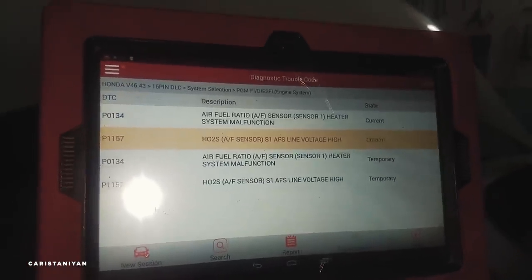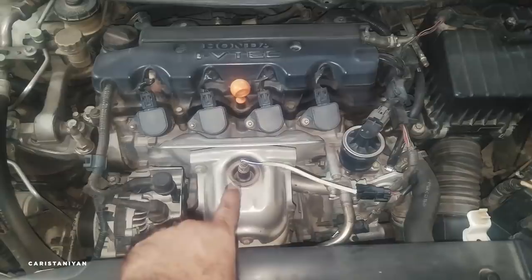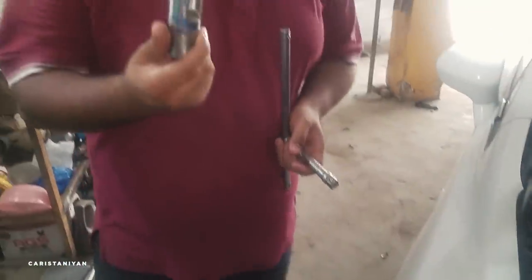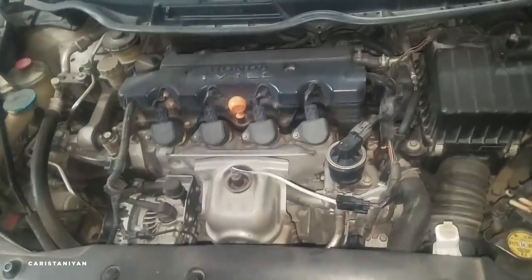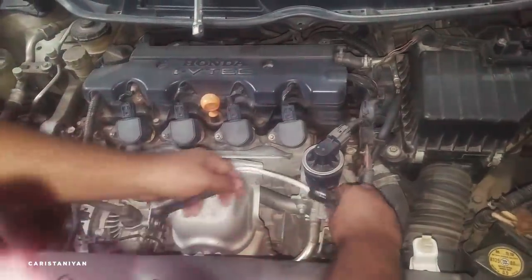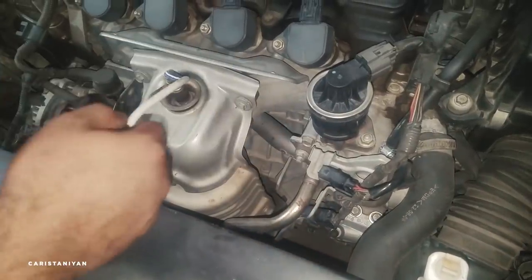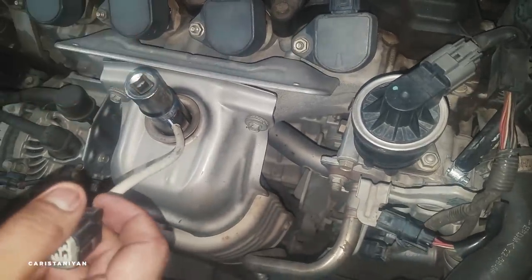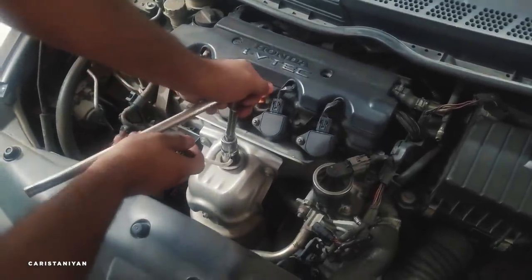Now let's see where the oxygen sensor is and how to open it. The Honda Civic model has an R18 engine. On the R18, on the top, this is the S1 oxygen sensor — which is on the top. Because of this code we will open it. This is the tool — a Chubby socket which fits the oxygen sensor — and this is the L-rod which we will use to open it. First step is to open it, and the L-rod goes below it and then is inserted to close and turn.